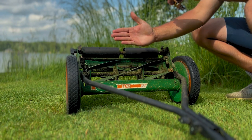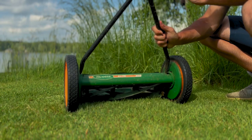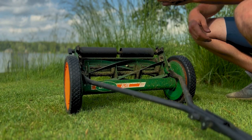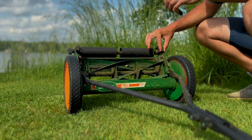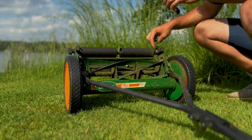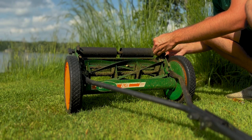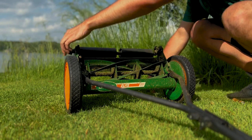When the mower is standing upright, you want the rollers to come up so the whole frame drops. On both sides you have a black block with three slots, and the frame has matching slots. There's a small square-head screw with a slotted washer that slides onto the black block easily. We're going to loosen up both ends.